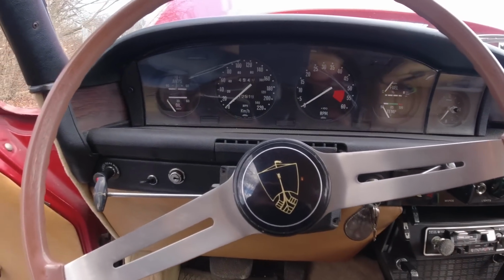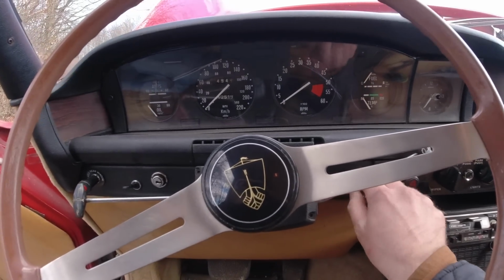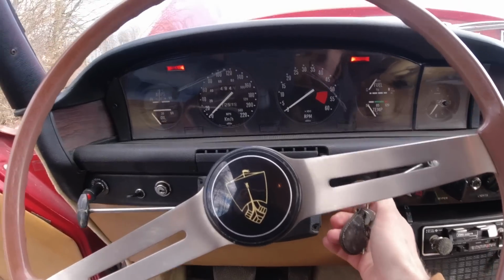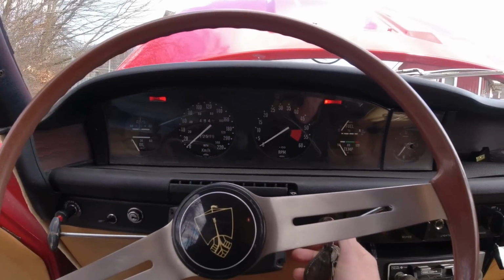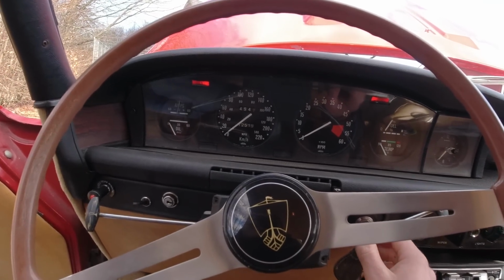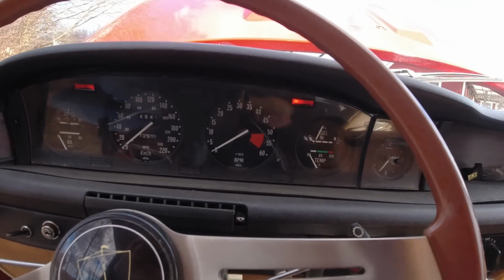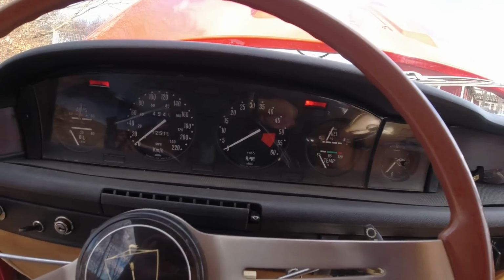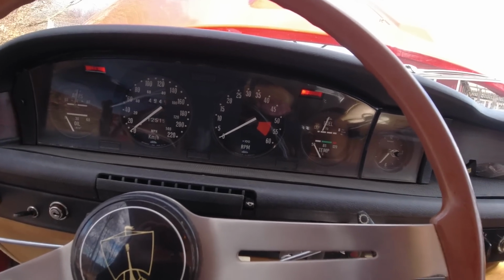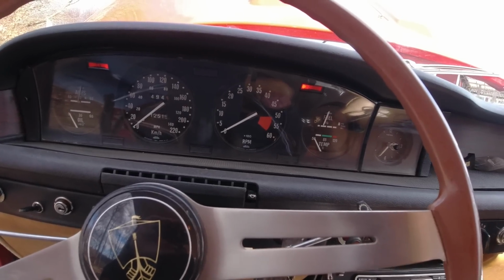Okay. Dash lights, ignition, and oil. Perfect. Let's see. I want to see what the fuel gauge goes up to, see how much fuel's in this tank. I've ordered a manual for the car, so I want to look at that, see if there's a good way to drain the tank. Otherwise, we'll use the electric pump. If the fuel looks bad, drain that out and just fill up with fresh stuff.